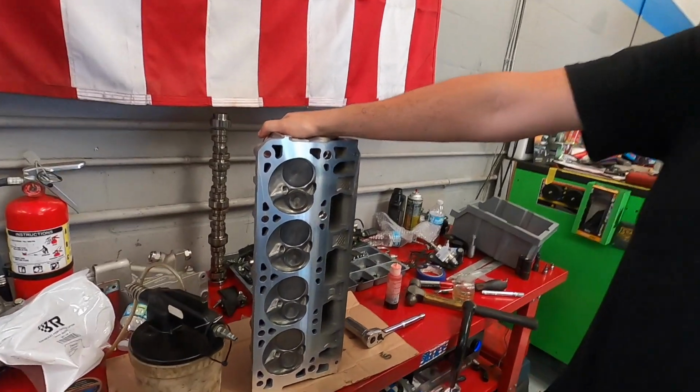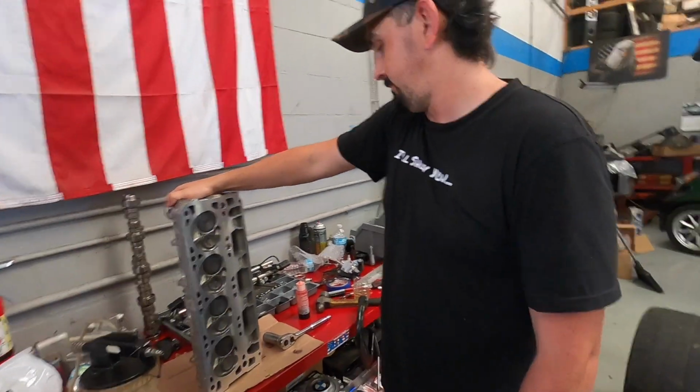It looks good. Smooth. All right, so the game plan here is we're trying to pick up in excess of 250 horsepower on this engine. We didn't get a chance to dyno it at baseline, but we've done tons and tons of them, and they dyno about 560 wheel horsepower. The manuals will dyno a little higher, as much as 580. My personal car, when I let it cool down, was right at 600, and these are rated at 650 horsepower at the motor. Something we discuss all the time is motor horsepower versus actual wheel horsepower. Big difference. Wheel horsepower is like engine horsepower after taxes.